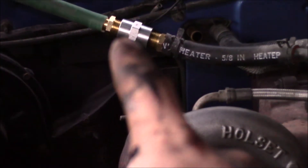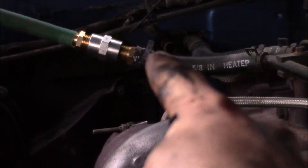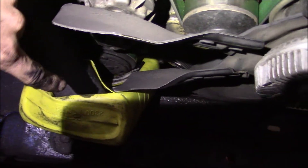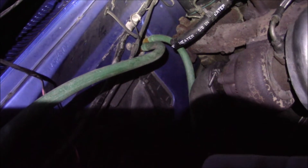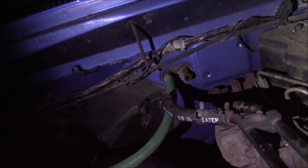Here's the setup I came up with to do this. I got some double 5/8 barbs running to the heater core inlet — you can see where I took the valve off right there. That is going to back flush the engine all the way down to the water pump. I hacked a hole in the bottom of an old jug of coolant, and that is going to act as my funnel so hopefully most of it should end up in there. It's actually really convenient flushing out the heater core as well, because a regular old garden hose cut into a couple of lengths works perfectly. Now that I got it flushed out with hose water, I'm going to top off the heater core with distilled water just to make bleeding the system a little easier later.